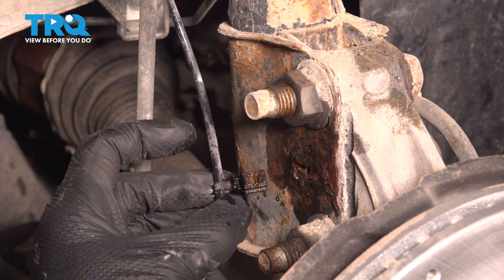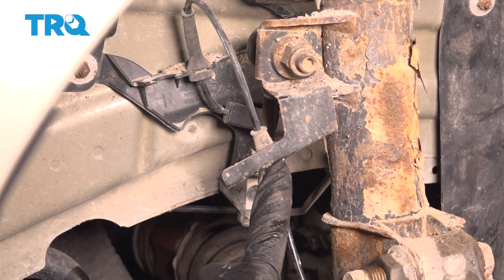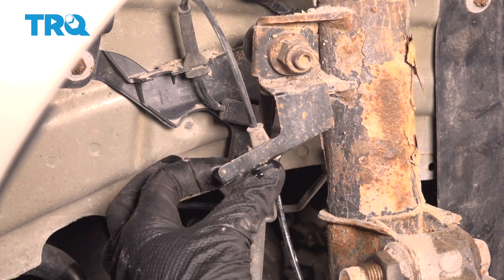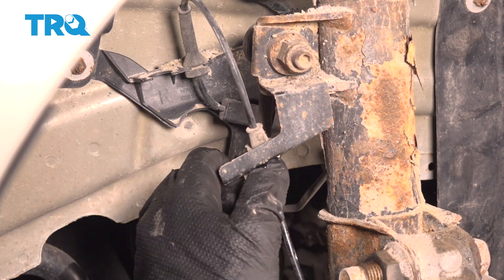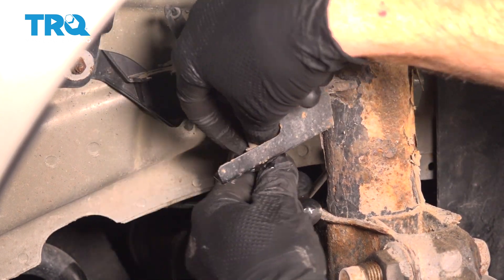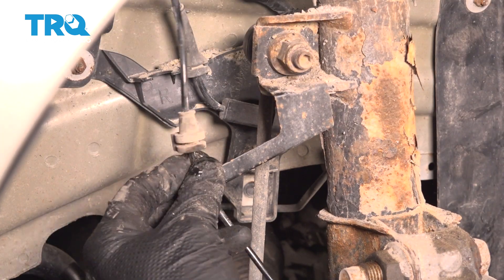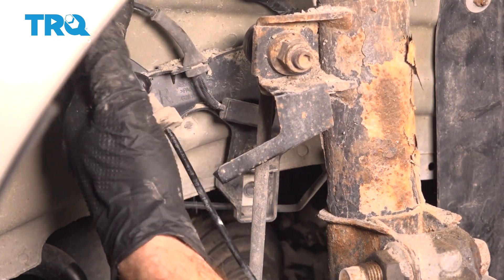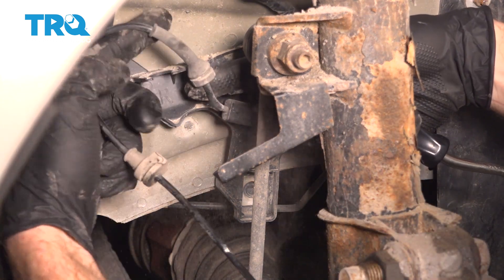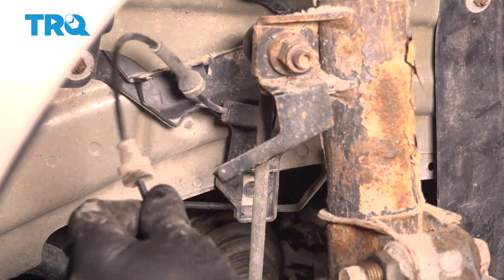A quick inspection. Once you have it out of place, we'll inspect the strut as well. Follow that upward. In this area, you're going to find the ABS wire goes into a bracket. Just go ahead and take hold of the ABS wire in the bracket and press that ABS wire out through the backside or the inboard side. Inspect the ABS wire. Up here for this one, we're just going to take hold of it and pull it out of place. At this point, we have plenty of slack from this ABS wire.